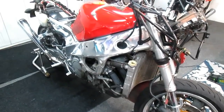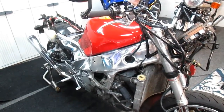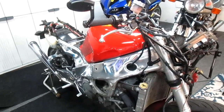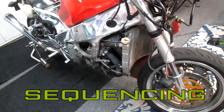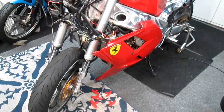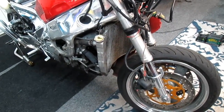This gives me a chance to get in there while everything is apart and clean it all out. My plan was to leave the fuel tank to the last, so number one I can leave the fuel tank on the bike and run it — if this goes into the long winter months I like to run it at least once every two or three weeks. Saving the fuel tank for last gives me an opportunity to clean up everything in here, run the bike, and make sure I haven't disconnected any wires or done any other silly things. So I'm pulling the rest of this apart and that might give me the opportunity to do some cleaning. I have my steam cleaner and all the chemicals, and I'd really like to clean that engine up while I have this apart.